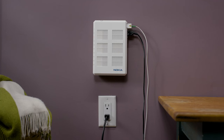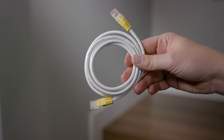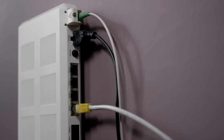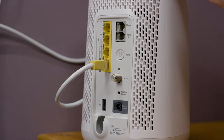Once you find your fiber terminal box, make sure it has a connected fiber cable and that these lights are on and are green. Find the Ethernet cable included in your kit. Connect the Ethernet cable to the Data1 or LAN1 port on the fiber terminal box. Then, connect the Ethernet cable's other end to the yellow port, called LAN-WAN-4, on your TELUS Wi-Fi Hub.